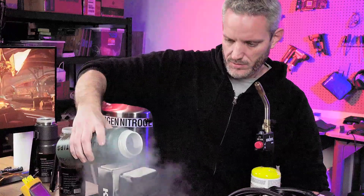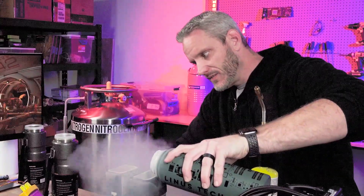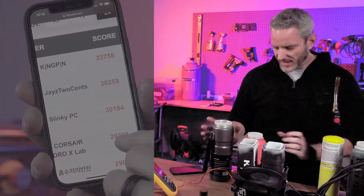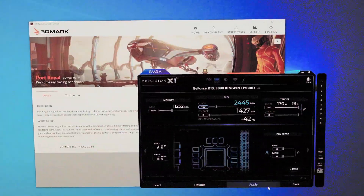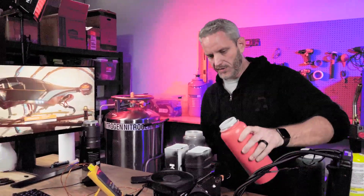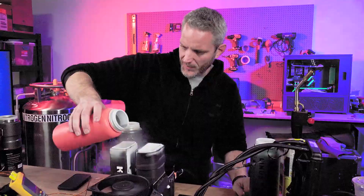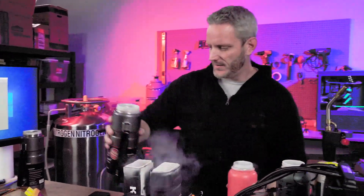We didn't get that many sounds before — just pouring it all over the motherboard. 32,087. I'm going to save that one unlike I did last time. So now I've got a pretty big lead ahead of where second place was. Now what I need to do is fill these up again and go again — a little more frequency. I added more core voltage and that's what got me stable. Now we'll try for like 2,450. It's so hard to get the pours consistent when there's two cards. I'm okay with the 32,000 because this is my very first experience with SLI LN2. The insulation came off right there because I poured it in between — and if it got down into where the mount is, then that mount is done to pieces and I don't plan on remounting it today.